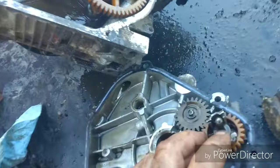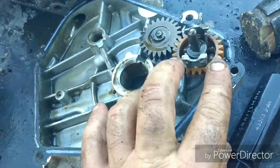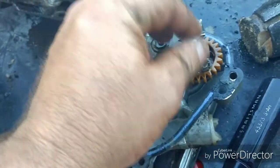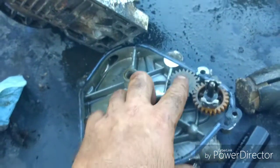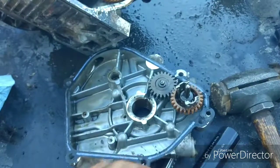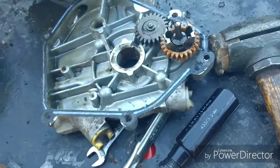I'm just going to be hosing this thing out and hosing it off, and just rip that governor out, which, I mean, that's no big deal. You just cut the gear on each side of that little lever, then you spread it open and it just pops off. And then that right there comes off with a circlip. I could actually just pop that circlip off and take that gear right there off and just leave that there. It ain't going to hurt nothing. It's not in the way, and it's not going to be hooked to nothing. But I'm going to go ahead and pull that out anyway.